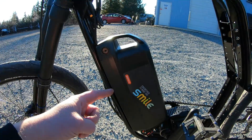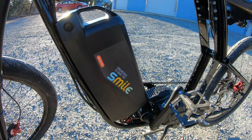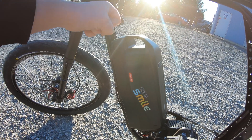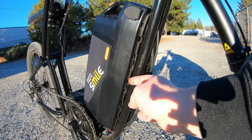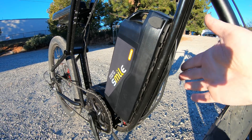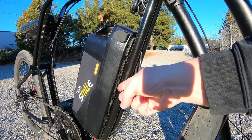I forgot to mention the battery capacity — this is a 19 amp hour, so pretty decent size. I think that's matched really well for a thousand watt motor. They also put a nice handle in the top of it, so when you unlock this it's super easy to grab the handle, pop it off the cradle that's mounted to the bike, and carry it inside. The cradle mounted to the bike has a lot of holes in it, so it's really versatile on the mounting positions. But even better than that — probably my favorite thing about the battery — is that the cradle isn't plastic. This piece is aluminum, or possibly magnesium, but it is definitely made out of metal, so it's going to hold up long term really well.